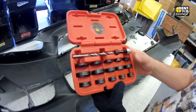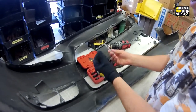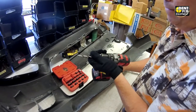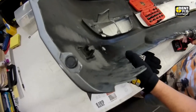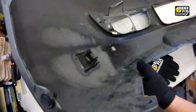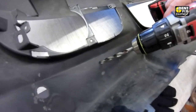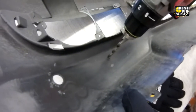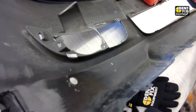So let's get this procedure started. We'll go ahead and take the drill bit out, place it in our handy drill, and lock it in. Look on the inside of the bumper for where the hole should be. In this case there is a sensor hole marking right here and we will drill through that very easily and cleanly holding the bumper steady. Fast and easy.